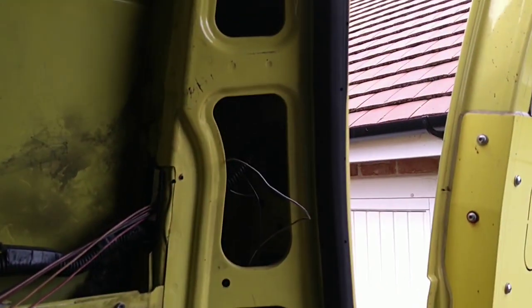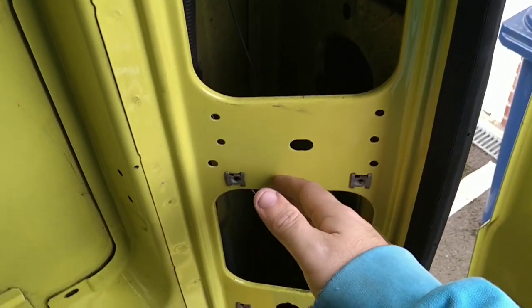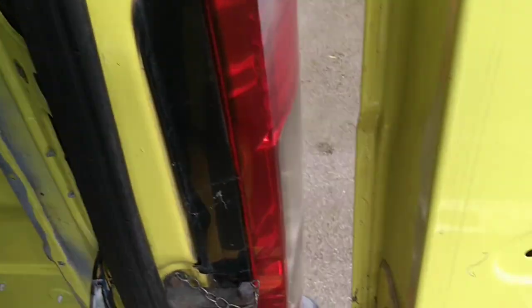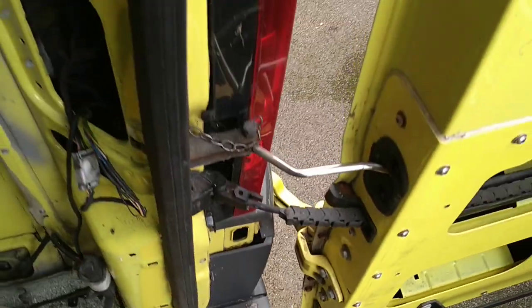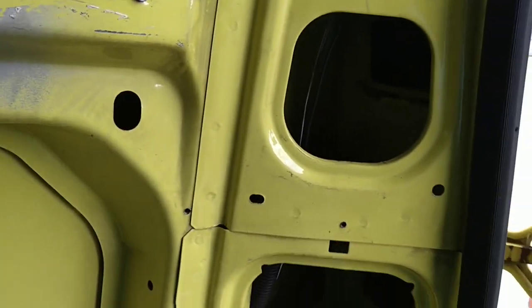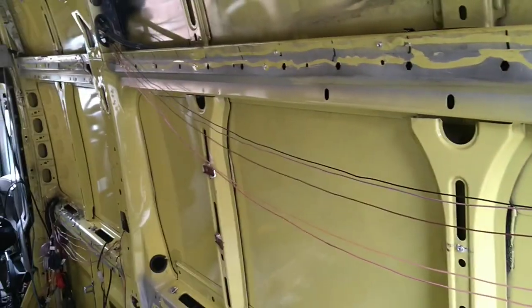On the other side there's a lot less coming down here now. This black and white one seems to be going down into the rear light cluster right down here. There's also a speaker wire going down to the speaker — so when you put it in reverse it's got a trigger on it that sets off the warning. I'm not entirely sure if I need that for the MOT, so I need to double check on that. But I already know there are significantly fewer wires than there were.